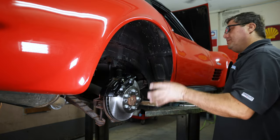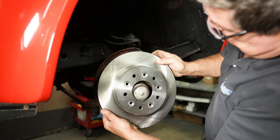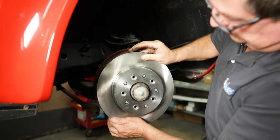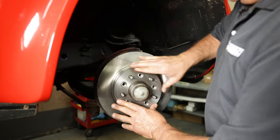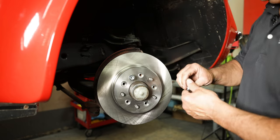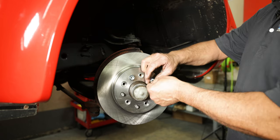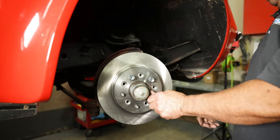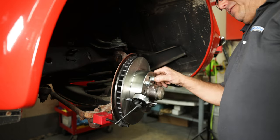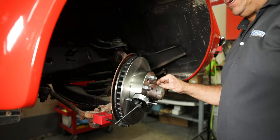This corner is done until we bleed the fluid out of all four corners. Install the new rotor on the hub. I did check the bearings — they're decent, the grease still looks fairly new. This car has just sat for over 10 years, and that adversely affected the brake system. Normal DOT 3 brake fluid is hygroscopic, meaning it attracts water and moisture — and that's where the rust comes from. On the front we got almost five thousandths runout, which is still under spec. I like it to be less than seven.